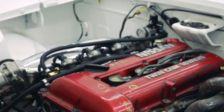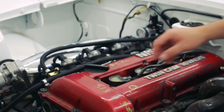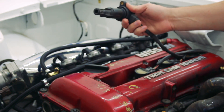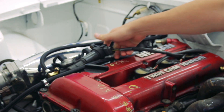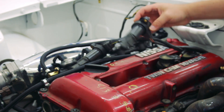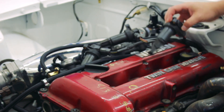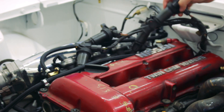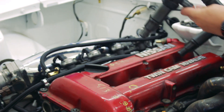In order to begin the installation process of the CAS, you will need to remove the valve cover. You should remove whatever covers the coil packs on your particular engine, then begin removing the coil packs themselves. In my case, I already have removed the screws that hold them in place, so I'm simply demonstrating where they are located. The coil packs are arranged directly down the center of the engine and lift directly off of the spark plugs. The spark plugs do not need to be removed in order to do this. The coil packs will need to be left off to the side, and ideally you will not want to pull, bend, or drop them in any way, shape, or form, so be fairly gentle with where you choose to place them.